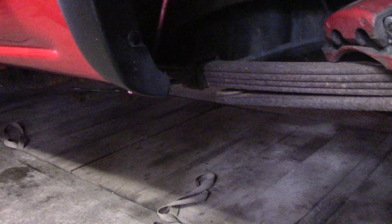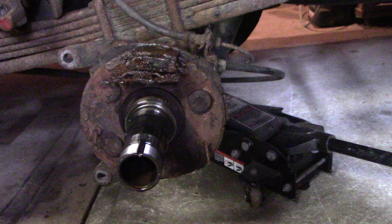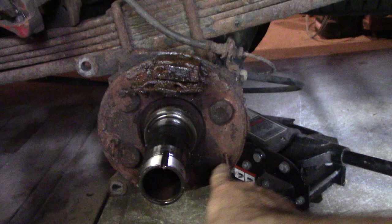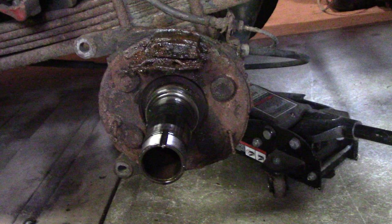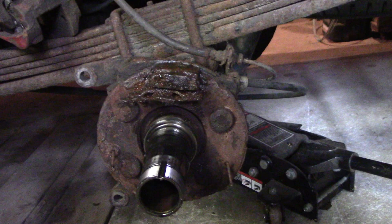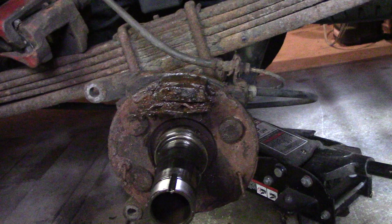I've got to get this whole parking brake kit, which kind of explains everything. I'm just going to put everything new at this point — it's my vehicle, labor's free. Here's the problem: there's no dust shield around here because everything just rotted away. Salt, crud, rust — stuff got introduced. So I've got to get a new shield, all the parking brake stuff, and some cables.